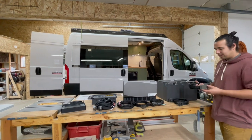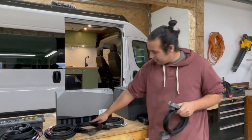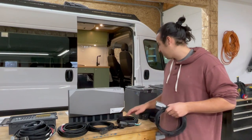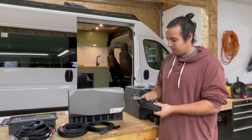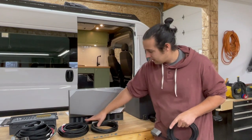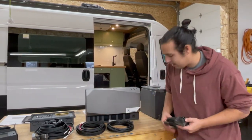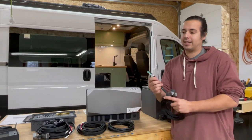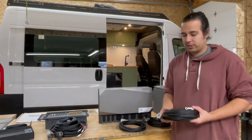All the cabling is right here. The battery cable lets you literally pop the top off and plug the battery in — there's no wiring, no fusing, it's a very simple solution. For inputs, there's a solar cable that comes with MC4 connectors pre-attached that plugs into PVN one or two — they've actually got two different solar inputs. There's also an AC in cable for shore power that wires to whatever shore power port you have on the side of your van.